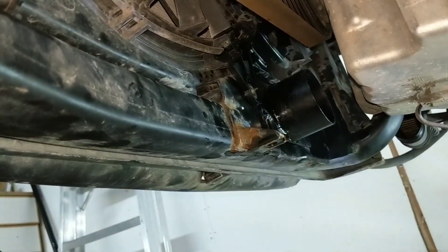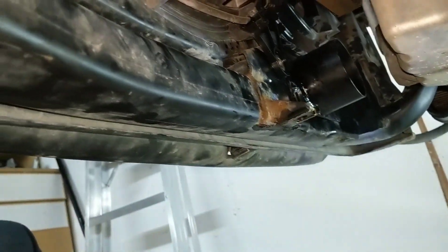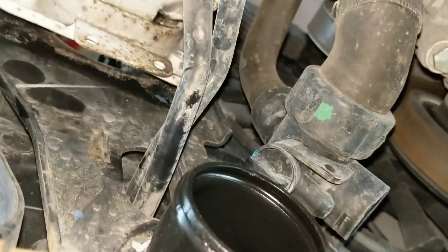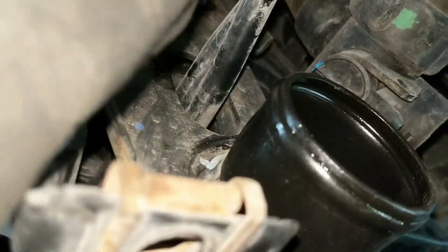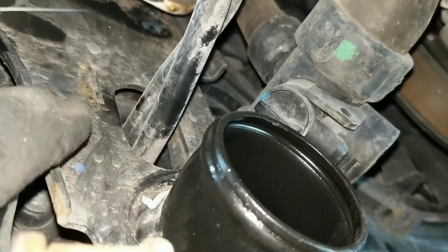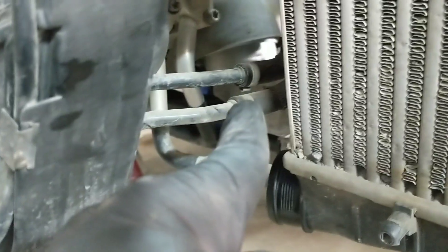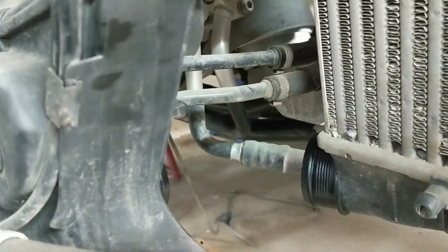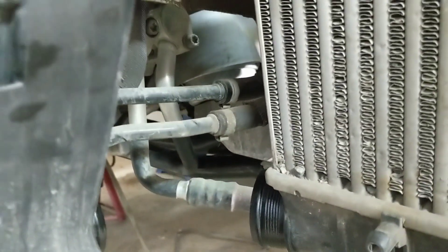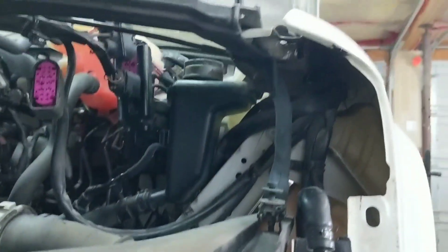I guess I'm not quite as smart as I thought I was. I have everything loose, and you actually could drop this out once you slid the lock carrier forward and slid this through the middle — it wouldn't interfere with the coolant. But what it turns out to be is the power steering cooler. The two lines run through the lower core support, so I won't be able to slide this thing out because of that. I've decided to pull apart the lines right here at the front. There's no place elsewhere where they've been connected with a band clamp that just screws closed, so I'm going to have to break these crimped bands anyways. Before I do that, I'll evacuate the system as much as I can with my MightyVac evacuator, going in right through the top of the reservoir.